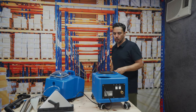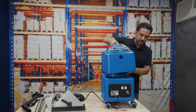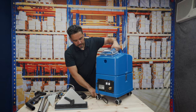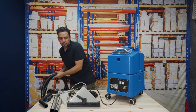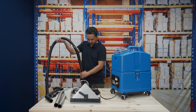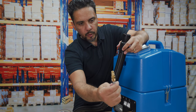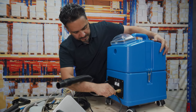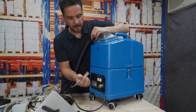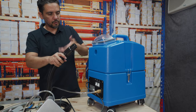Once you fill the clean water tank and mix your carpet shampoo in, put the top on — there's only one way it can go on. Then grab your hose: it's a 2.5-metre, 38-millimetre vacuum hose. One end has a male fitting — a quick-connect brass coupling — that pushes straight into the front of the machine. To release it you just press the coupling. Make sure you depressurise the machine before removing the hose, and I'll show you that later. That's where your solution comes out — when you turn the spray switch on, water will come through the clear hose, and whatever you're extracting goes into the dirty water canister.